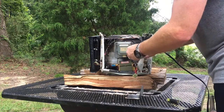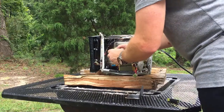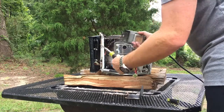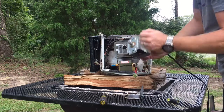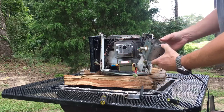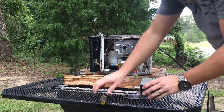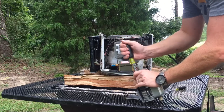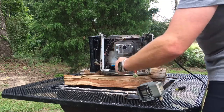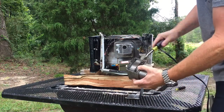What we want to do is get the magnets out of the magnetron — you can use the magnets for all kinds of things. There's a seal on the magnetron that's usually what makes them bad, but this one wasn't bad, we just couldn't kill the microwave. You can see the two round magnets right there. This one has a set screw holding the top piece on; usually you have to pry the top off since the ears are bent down and it's kind of pressed on. This one has a set screw on each side, which is actually nicer than most.